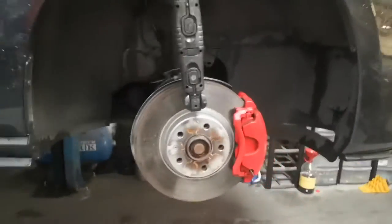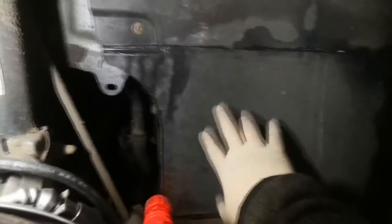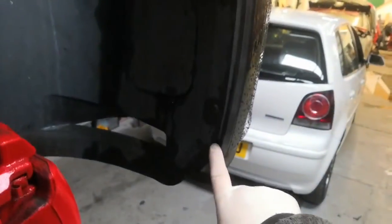So I've got it in there. I'm taking the wheel off on the driver's side — or if it's left-hand drive, then yours will be passenger side. I'm going to start by taking this bottom half of the arch liner out. It's just these T25s — there's one there, two, three, four. And then there's some on the under tray.